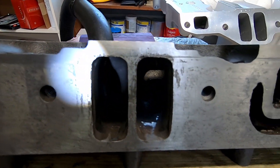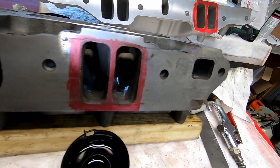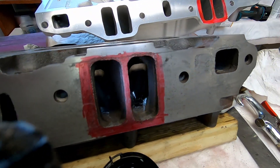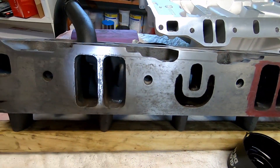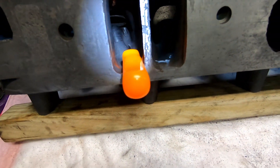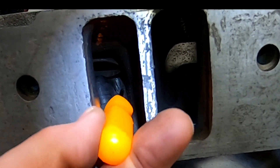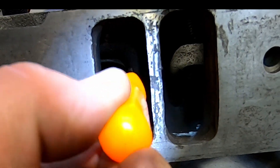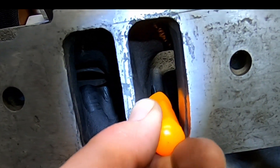Our pushrod pinches are much, much better. I went ahead and went up to the top just because it only took me a few more minutes here and there. I went ahead and just worked that wall all the way around as far as my bit would reach. Then I swapped to my long egg bit. What I'm going to do now — I have laid my pick on top of a spot that we're going to target. As the air comes in that spot right here, I'm going to knock it down some, go ahead and open it up, blend it further into that side, and open that wall up. We don't want to get into a water jacket at all.